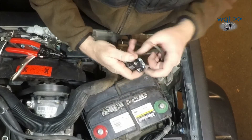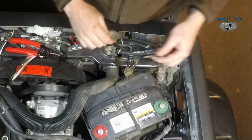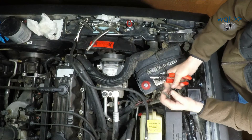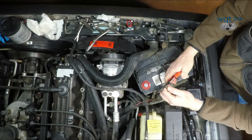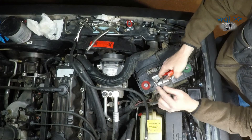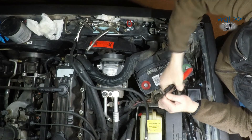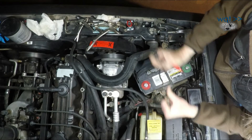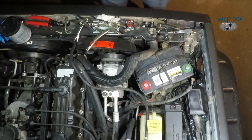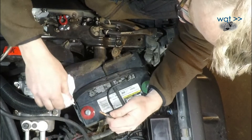That's not looking bad at all — I should be able to get a good clean termination out of that. Let me check lengthwise how it does on this particular type. Notice I have captive hex bolts — be careful not to over-extend or you'll have to chase them under the vehicle. That's looking like just about the right length. Now I'm going to do the same thing to the second wire. This one might be six gauge — I might still convert it to number four since it's the main block ground and has to handle all the return current including the alternator.